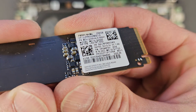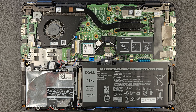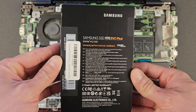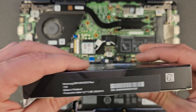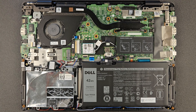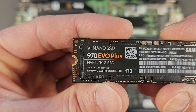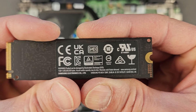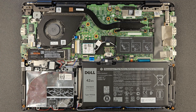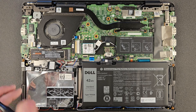A closer look at the SSD, and that's the new drive going in — one terabyte as I said. Good drives; you can get faster, better ones now but this is good for this job. I do recommend them. One thing to note: when upgrading your solid state drive, you will have to reinstall Windows on it. That's about 30 minutes plus another 30 minutes to update drivers, but it's easy enough these days with Windows 11 and there are many tutorials available.